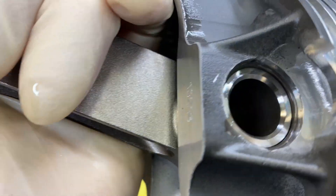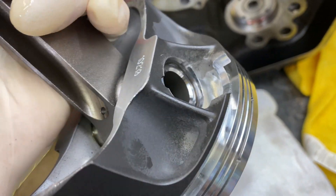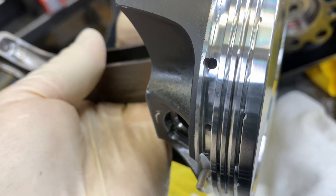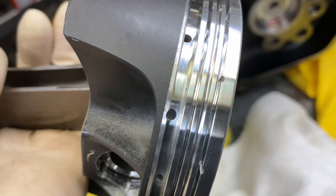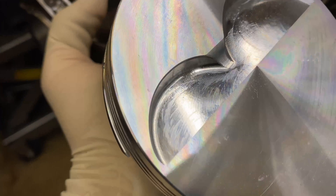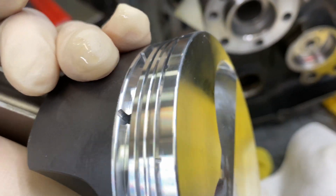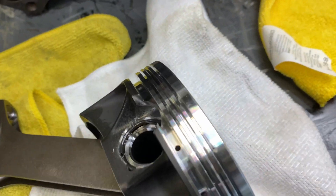On all of the edges — yes, it's got a skirt coating. It's got the stabilization ribs. Very, very good quality. See the gas port on the top ring? Nice, nice quality. This happens to just be a flat top — it's five cc's. Let me set this down and get a good zoom.